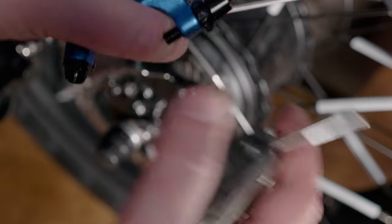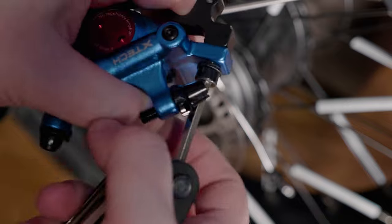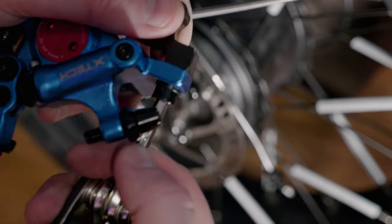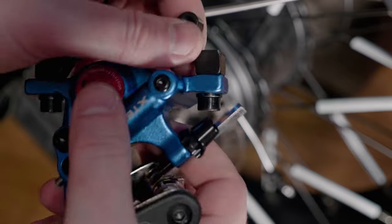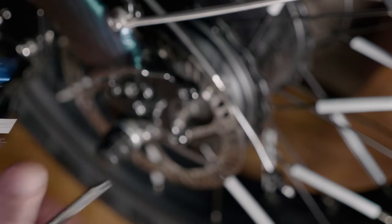We're now preparing the new brake calipers for installation. Tighten the bracket all the way up and then do a 1/4 turn the opposite direction. And that'll make the brake caliper and bracket kind of loose. And then when you get everything installed, this will help you make adjustments to the brakes once you get to that point.